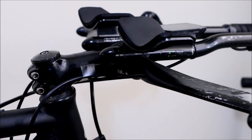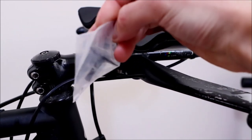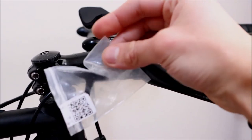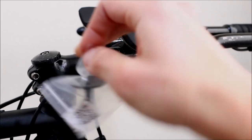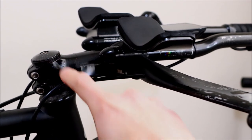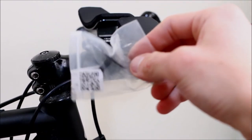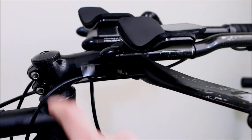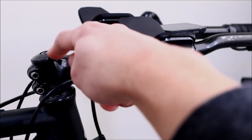You know what? I want to mention something. So I have this top cap. It's like this one piece design thing, and the top cap is integrated into the screw and it's a lot lighter than this, even with the titanium bolt. But before you go out and buy this one, if you see this around, I'm going to tell you not to. I know you might say this doesn't really do anything except put tension on the headset, and the stem is what holds it in place. But every time I run this, it gets loose and I'll get play in my headset. So that's why I stop using these and I go back to this. That's really weird. That's the only variable I change, so this must do something.